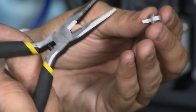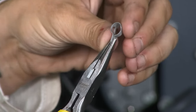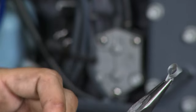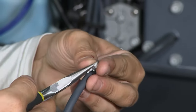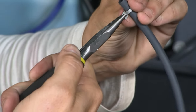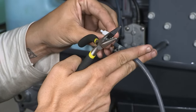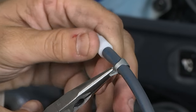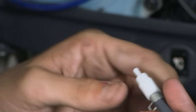What I always do is take a pair of needle nose pliers and grab the two wings. If you squeeze them together, the circumference of the circle will end up opening up and expanding. With that, you're able to feed a hose through it, put the hose on the barbed nipple, then open it up, slide the clamp over the nipple, release it, and it will end up holding the hose in place.